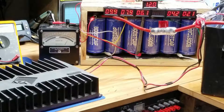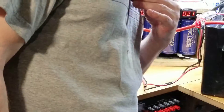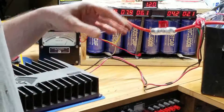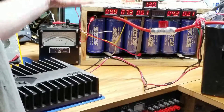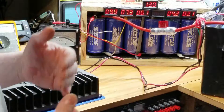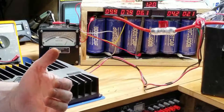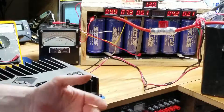We got five minutes, 48 seconds out of that. You should know that this battery is probably 12 years old, so the drain rate isn't really what we're judging — what we're looking at is how these individual cells behave as we put a load on them listening to music, which is really the intent of this entire combination. Next, as I take the caps out, recharge the battery, get it back to 12.9 volts, and start the track over again, we will see: did it make a difference? Honestly, I have no idea — I haven't actually run this test before.